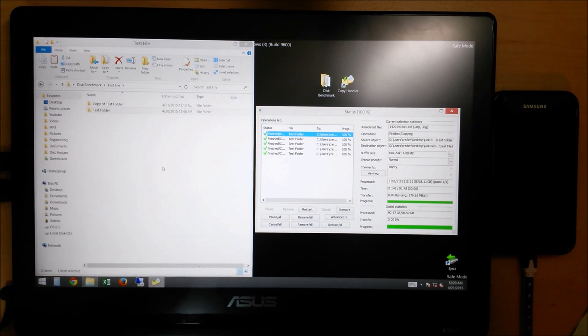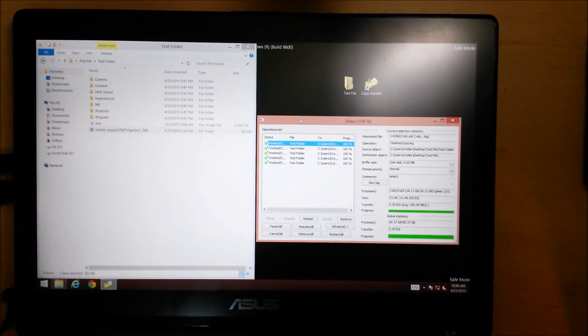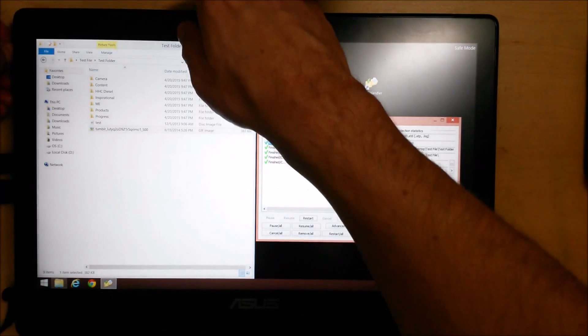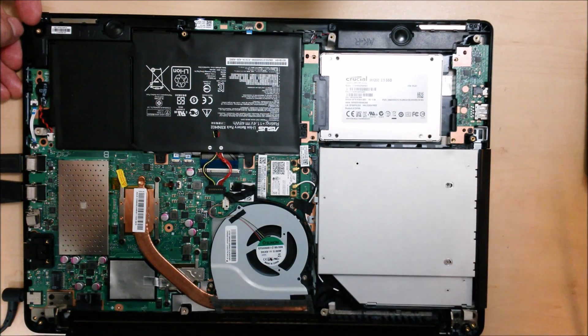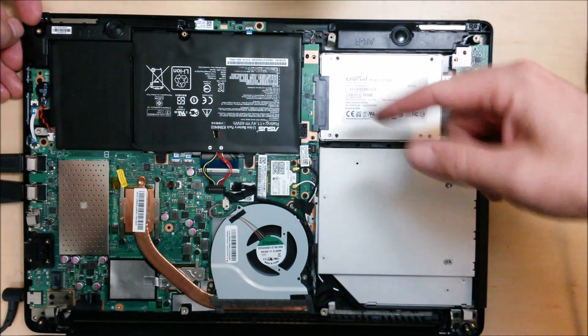That's much less than the 500 MB/s they're capable of, and that's because with pictures, it's a bunch of really small individual files and each one has to be transferred individually, which slows things way down. But it's the best way to give you guys a real world idea of how these drives are going to perform. Now moving on to the Crucial MX200: unlike all my other tests, the Crucial MX200 actually beat the Samsung 850 EVO in the file folder copy test — I got 1 minute 36.4 seconds, which is actually pretty good and a pretty impressive lead.